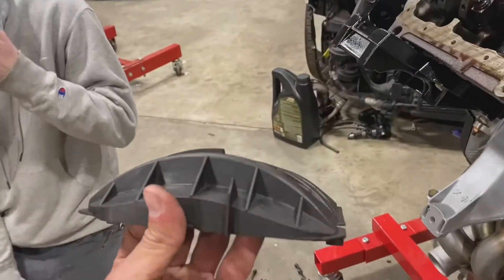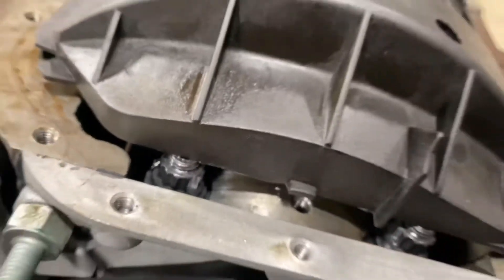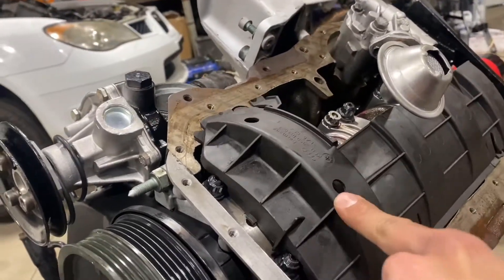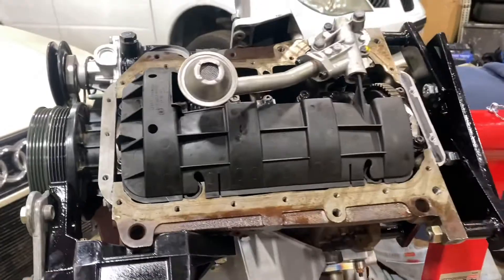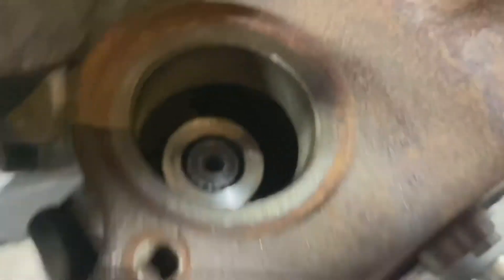Oil pickup is on. This little plastic piece goes in there as well — that little quarter circle and that little quarter circle coincide with that clip, and that peg goes in there. If you have ARP main studs, you will have to trim this little tray for it to fit. Cleared those spots so the main studs will fit. I'm a bit concerned because it has a lot of play, but I think when the oil pan is bolted down it holds it in place, so we're going to try it. You'll set the gear in place and you might have to crank the engine until the gear lines up with the other shaft, and then it'll fall into place.